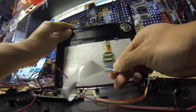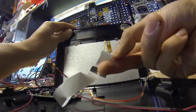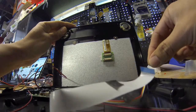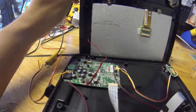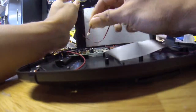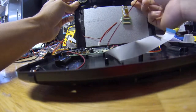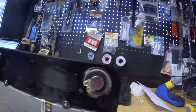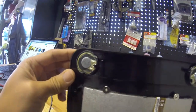The blue stiffener is going to face towards you, and the contacts on the stiffener — little silver guys — are going to be towards the LCD. Once that's disconnected, you're also going to want to remove the power cable going from the LCD to the main board — that's just a standard type connector you can pull straight up with your fingers. Next, you're going to have these speaker wires that are soldered to the speakers; I just desoldered them. The speaker drivers are actually labeled with positive and negative, so you can easily figure out where those wires should get soldered back.